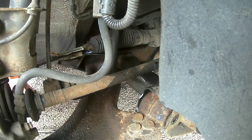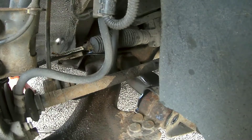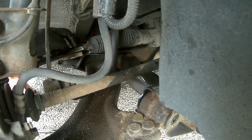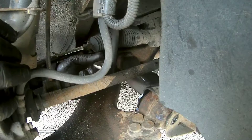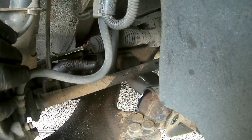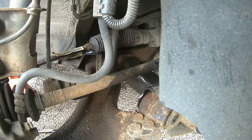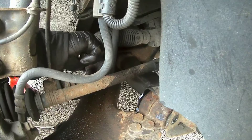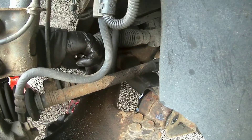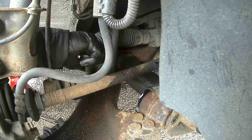This is literally the best shot I can get, but you need to slide your spanner up over the top there. There isn't a nut visible on the top — it's hiding — so you have to sort of feel your spanner onto the top of it. Then I'm going to stick a gun underneath and whizz it off. Obviously you can use a ratchet or spanner, whatever is available to you, just holding the top spanner in place and then blitzing it out with the gun.